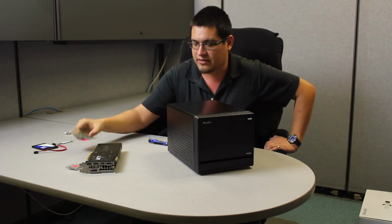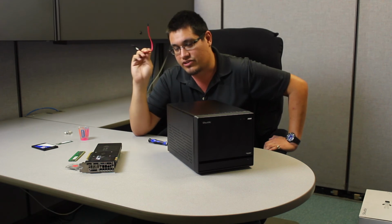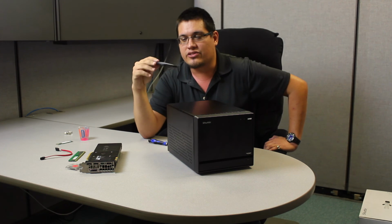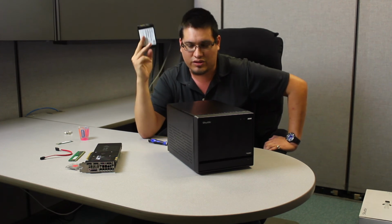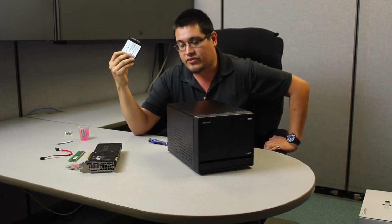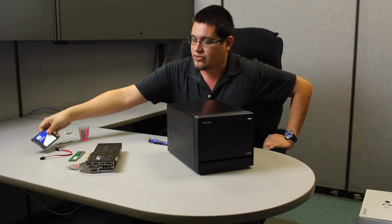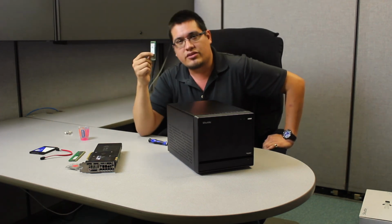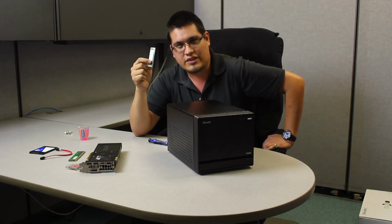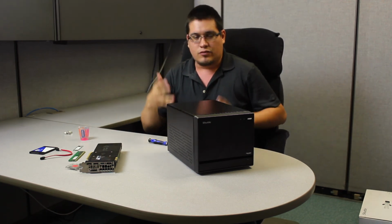They're 2x4 gigs. SATA cable, you might need this, you may not, depending if you choose to use a drive. Like this one. This is a 2.5-inch SSD, Western Digital Blue, 250 gigs. This also applies if you're going to use a mechanical drive. This unit can support 3.5-inch drives as well, so you'll still need that SATA cable. And here's an M.2 drive. I decided to include this just because I do get a lot of questions on how to install an M.2 drive. A lot of people get confused. I'll clear up that confusion. So, jump back into the build.